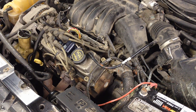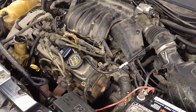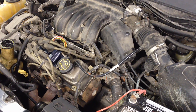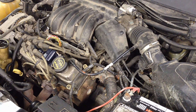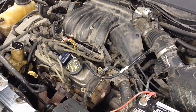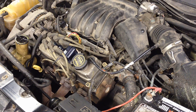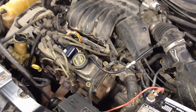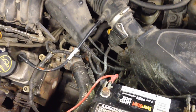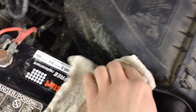I've got a 2003 Ford Taurus that needs a starter. It's more of an intermittent crank situation, and this one actually has an issue where it seems like a battery problem because the brushes are so oil-soaked that they just don't have contact. I'll show you why and how these fail — it's a bad design, and this one had an oil leak on top of it to make it even worse.